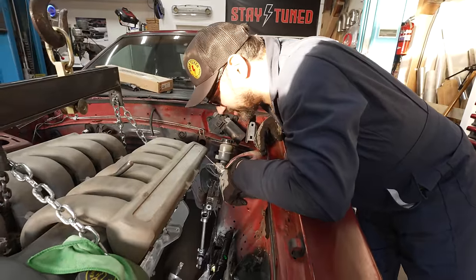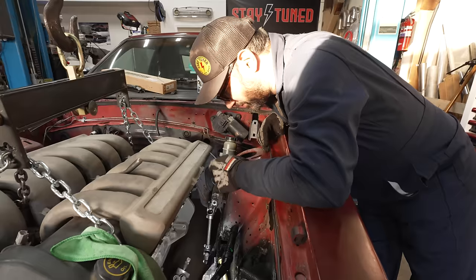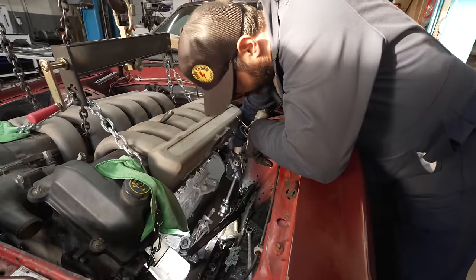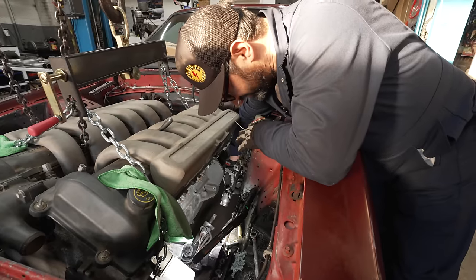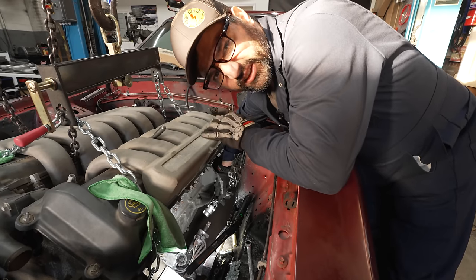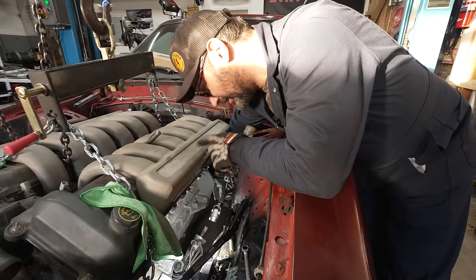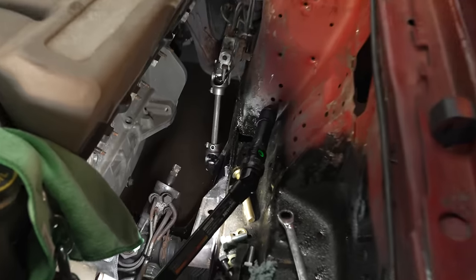We need this steering shaft in for making the headers, but before final installation I will pull all of those set screws and lock nuts out and Loctite each and every one of them. Make sure they stay tight. Anytime you use one of these universal style D shaft type steering shafts, you gotta Loctite them at a minimum. I really like to go in between the holes where the set screws go, do a little divot with like an 1/8 inch or so drill bit, just to give the set screw a place to sort of nestle into. Loctite it, then Loctite the nut, and then I feel confident about it. Because it's your steering shaft, you want it to stay on there.